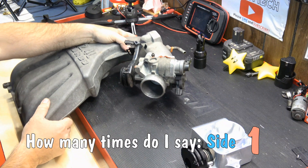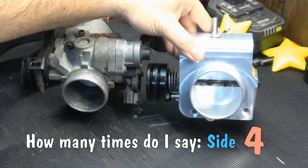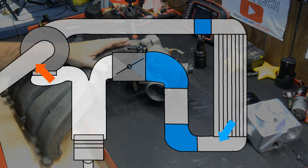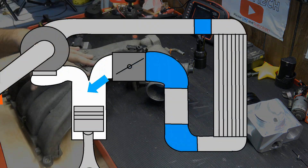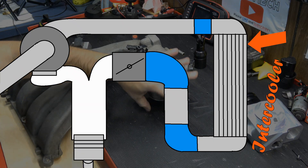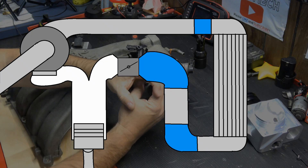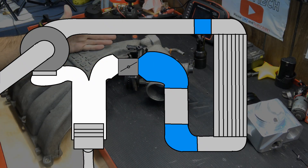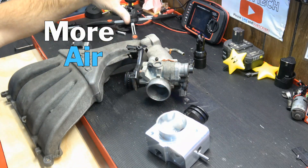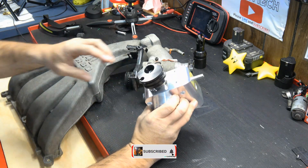We're back inside — it's a lot warmer in here than it was outside. I'll put these two relatively side by side so you can kind of tell the size difference we're getting at here. With a turbo engine, the name of the game is squeezing as much air into the combustion chamber as possible. So you have a big turbo, you have an air cooler, then it shoves the air right in through the throttle plate. Well, if your throttle plate is small, it restricts the amount of volume that you can get into the combustion chamber. What this new throttle plate is going to do is allow more air to enter the intake at any given time, plus it's supposed to help out with throttle response.